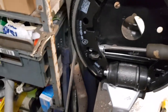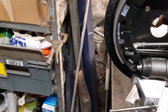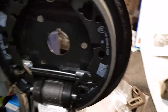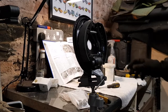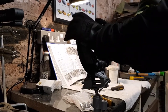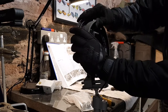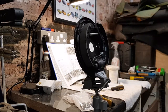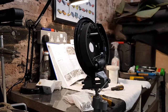You can see from this helpful photo what we're trying to achieve. The spring which is just a coil in the middle goes at the bottom between the slot and the hole. There's another spring which is like two coils separated by a straight bit — that goes in the slot at the top and the hole at the top, and they go behind the shoes. I had to swap to the vice to get the spring on. I hooked a cable tie over the end of the spring through the hole and pulled it, while at the same time using this modified old screwdriver with a groove in it to push the spring along — and boom, popped on. The top spring is much easier if you just pop the two brake shoes loose and pivot them on. Just got a little bit of grease on a couple of these points up here and then we're done.